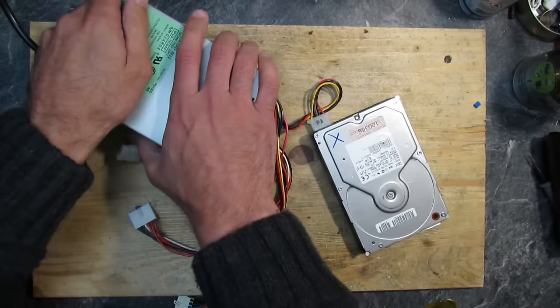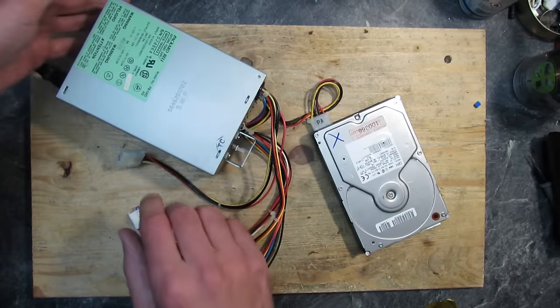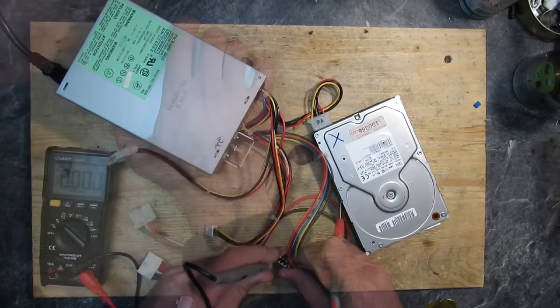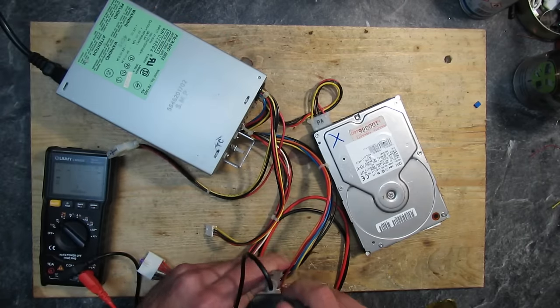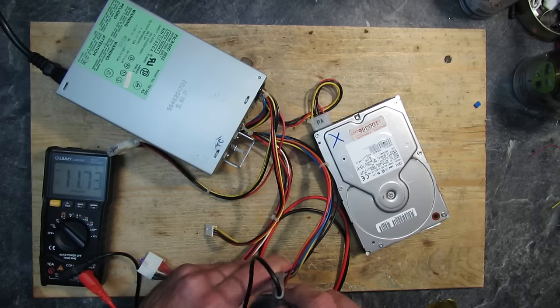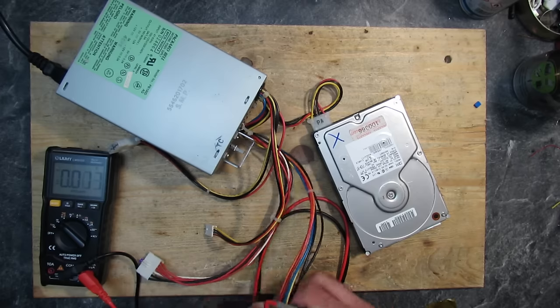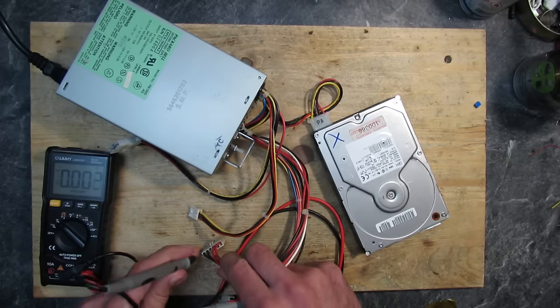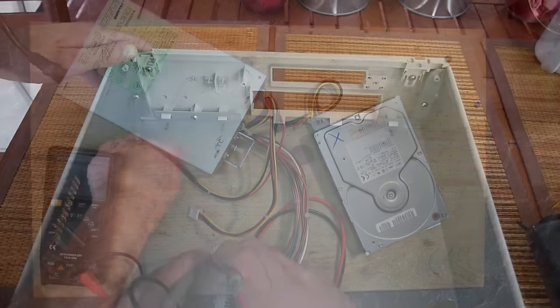The PSU was unfortunately still quite loud. The fan works well, but should probably be replaced with something more silent. But at least the voltage looked okay. For plus minus 12 volt, I got around 11.7. And for plus minus 5 volt I got about 5.2, which is slightly high, but with more load it would drop a bit, so I consider it good enough.